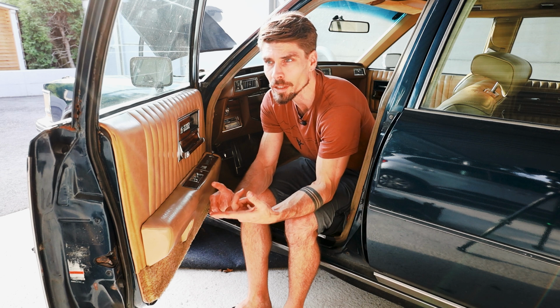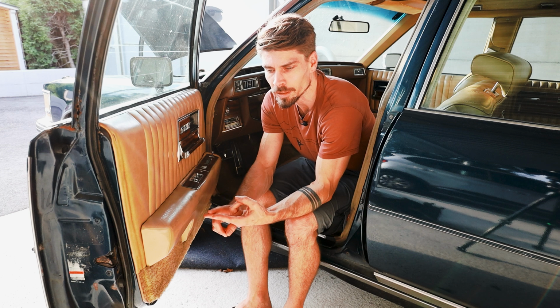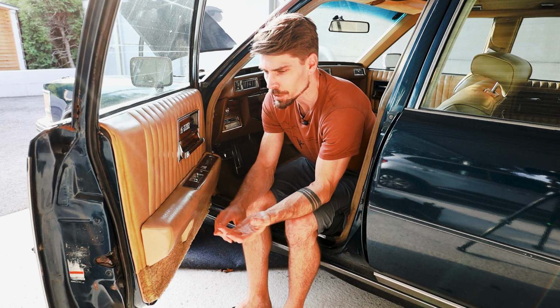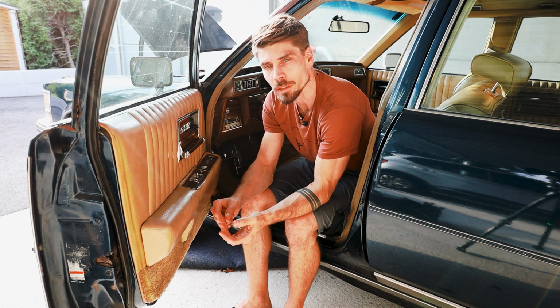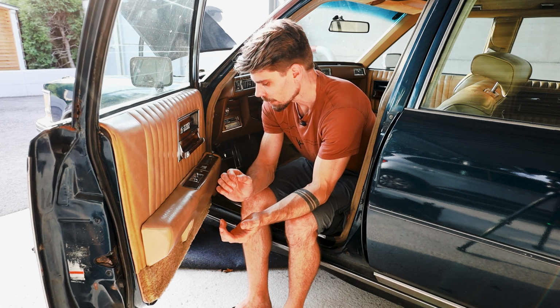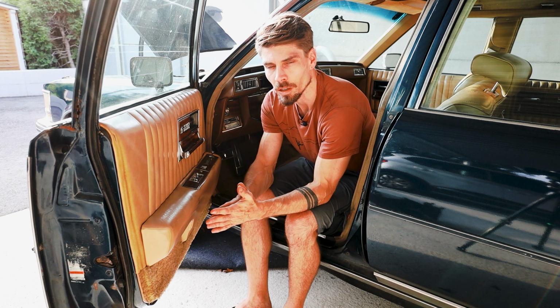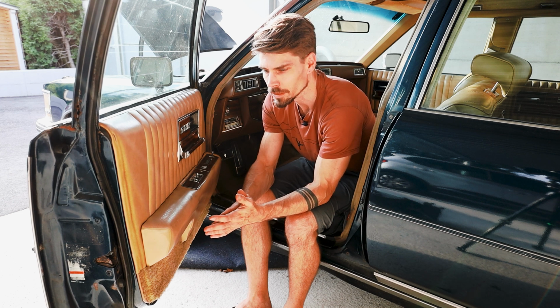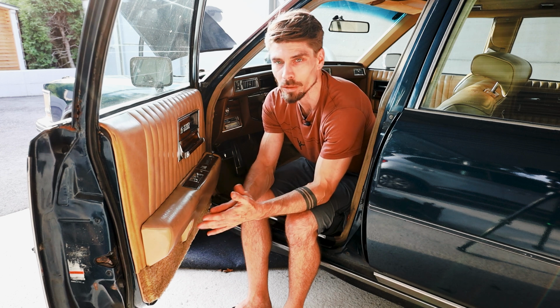I ordered a new one, I disconnected the antenna, I pulled out the generator and disassembled it, measured the diode trio, the rectifier bridge, and I measured a bunch of other stuff. So the next big thing I want to do is disconnect all 3 connectors of the ECU and hope that the reading changes. If not, the next big thing is disconnecting all the main plugs, like the body, the trunk, seats, all sort of things.